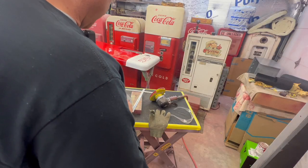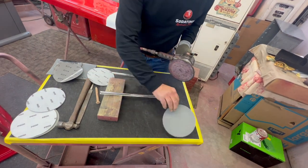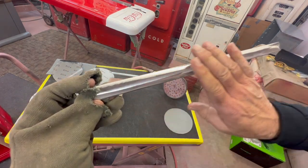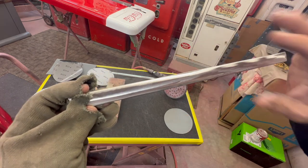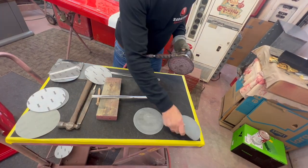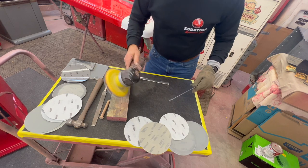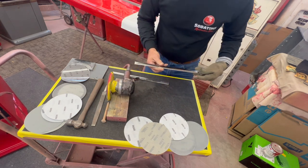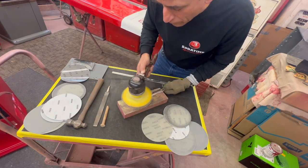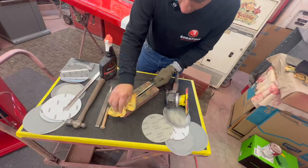This metal will get extremely hot, so I'm going to get my glove on so I can grab the other side. We're going to go down to 600 on our next one, then jump up to some 800. All our dents are out. Our next process, we're going to start taking a little bit of that finish off and we should start seeing the gloss coming back. We went 600, 800 — we'll go ahead and jump up to 1500. The gloss is coming back pretty quick. Now that was 1500 — now we're going to 2000. It's looking good. We'll probably take it over to the buffer now and just finish it.